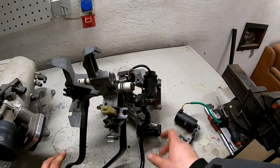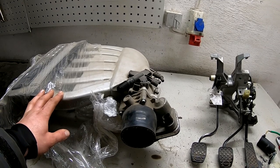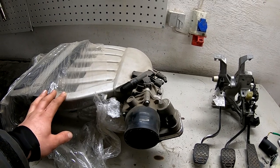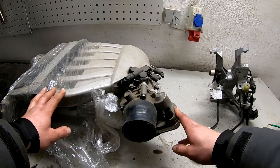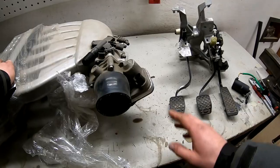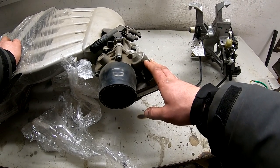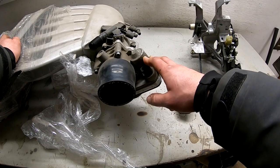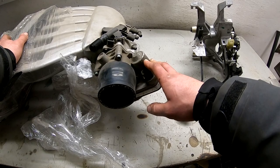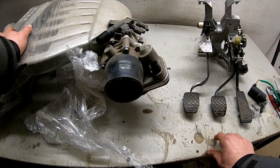So why do I need a drive-by-wire pedal anyway? I need drive-by-wire because these VR6 engines have e-throttle from factory. You can change it to a cable one if you want. With e-throttle you can have a lot of cool features with standalone ECU. And I think the cable one is not so popular anymore. So that's why I keep this e-throttle and install drive-by-wire pedals.